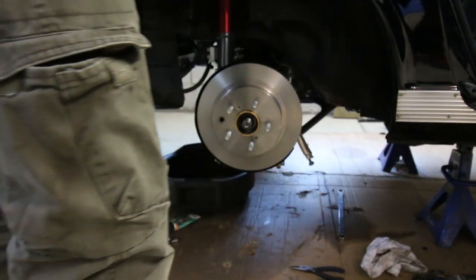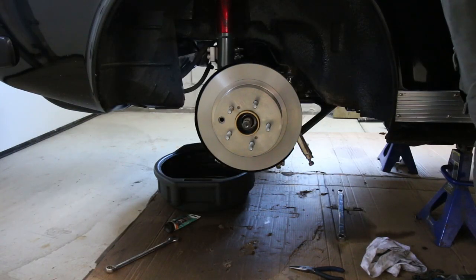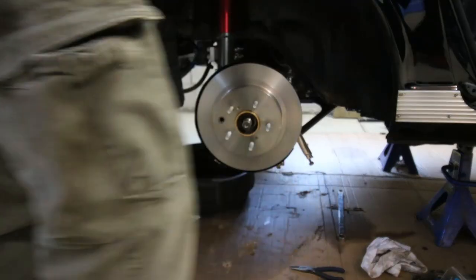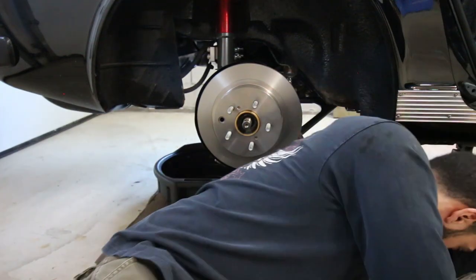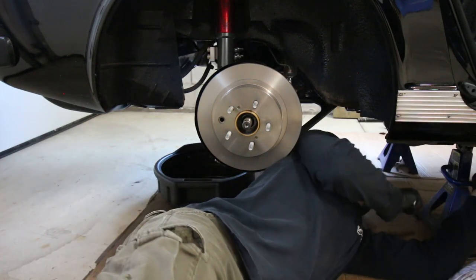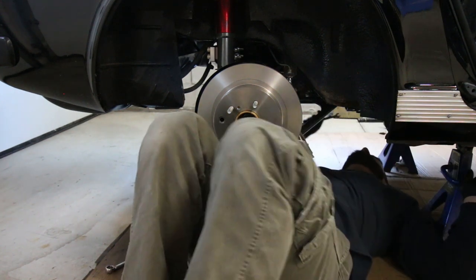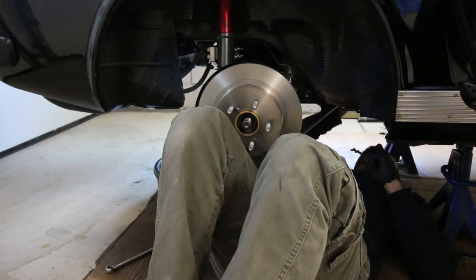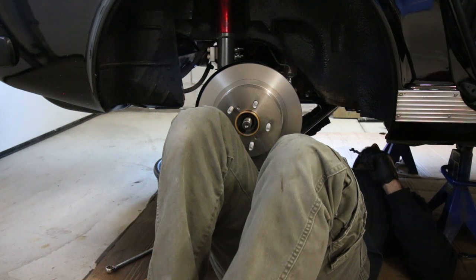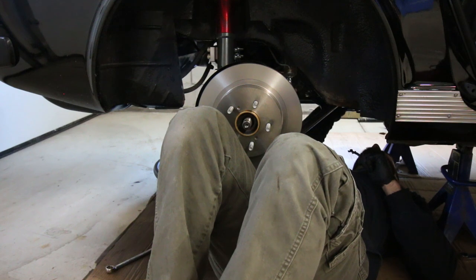Started, or not? No, nothing. Look how easy it was to pull it down. You've got probably about 4 or 5 inches of slack on that cable. Has to be. Or it's not connected inside the car. Is it not connected inside? Because I pulled the thing right up with a pinky. It should be really hard. Pull on the e-brake. I want to see what happens. See what it's doing? Release. Nah, it's doing nothing.